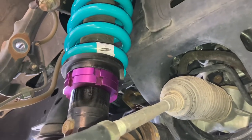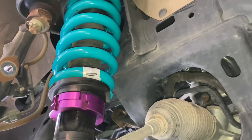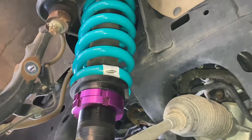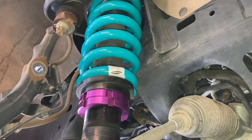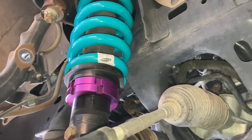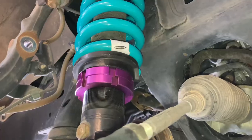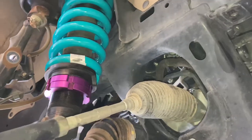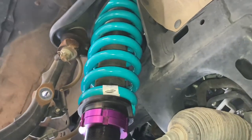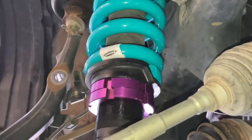On other vehicles with these 350 springs and a steel bull bar, they sit quite high — 790mm or even higher. We figured the weight of a bull bar would drop it about 20mm, so we dropped the spring seat 10mm, plus Anthony likes it a little lower, so we went another 3mm — setting at 200mm on the dot. We started off thinking to drop only 5mm, which would have been 208mm, but after comparing all the vehicles we've done we went to 200. Without the bull bar we ended up around 770mm or lower, so we should have set it at 208. If you haven't got a bull bar and want these heavier 350 springs, set it at 208. Subscribe and turn the bell on for more videos. But we're unable to accurately measure and set the 208mm from the spring seat hole while it's in the vehicle.